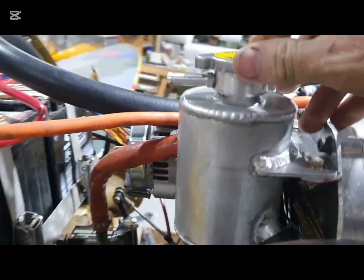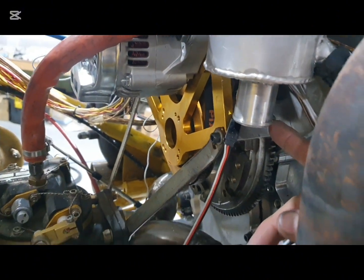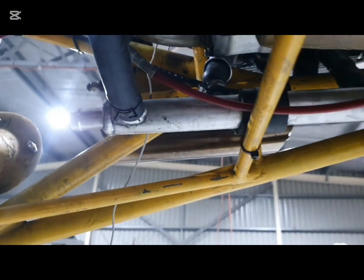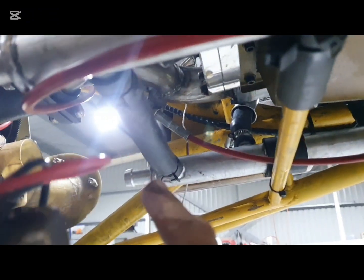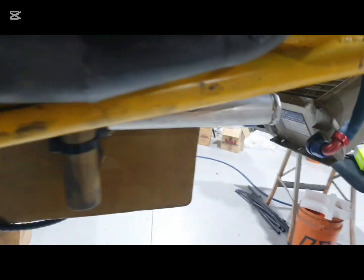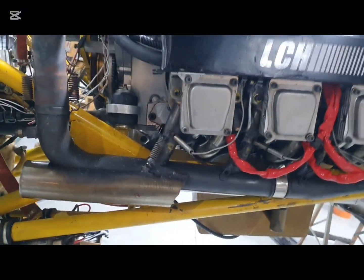The header tank is custom — it's got a bigger port on it to accommodate the twin pump system. I've got two common rails under the engine, feeding water pipes all the way up to the heads — four on this side and four on the other side. I've also got a cross-link here with three-quarter inch fittings going through that gap. Two pumps will feed those, bridged in parallel, as are the other common rails — bridged at the front and rear as well. So it's basically one circuit, all in parallel.